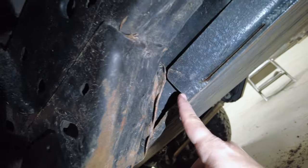Drill it out - it's only metal, it'll be fine. That should be good enough. Now let's bolt it on. They send spacers to go behind the skid plate in between the Bronco frame rail and the skid plate. Your bolt goes through that, then they give you this little tab with nuts welded on it and they thread right in. Push that up in there - nice that you can hold on to it. Once threaded on both, tighten down your main trailing arm bolt and you're done.